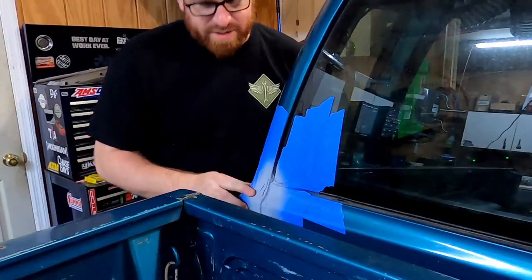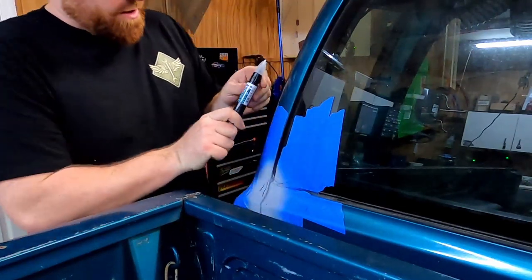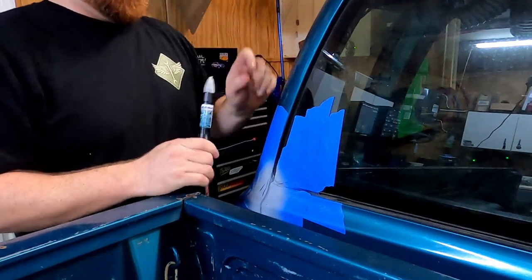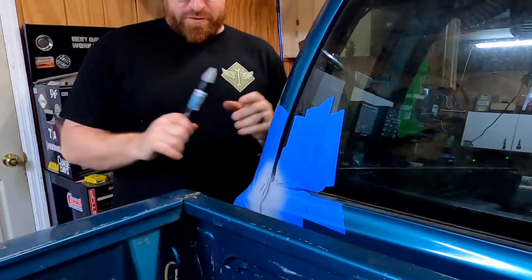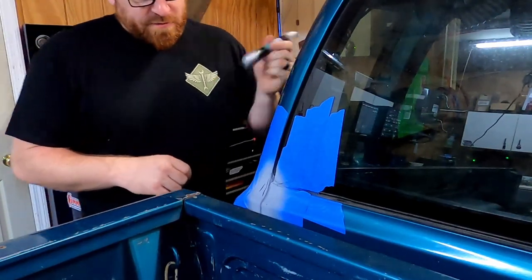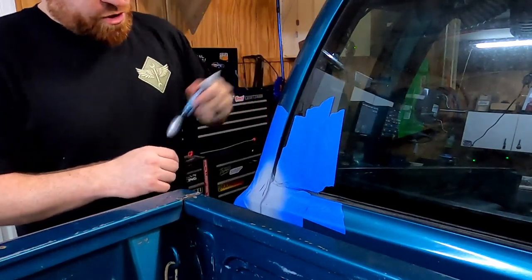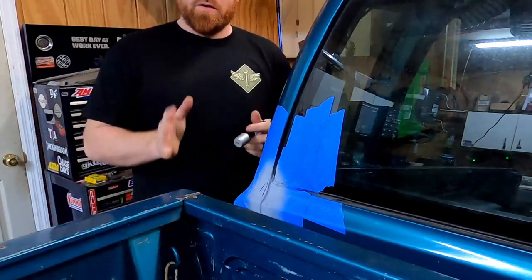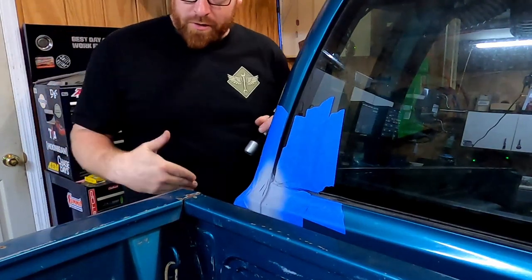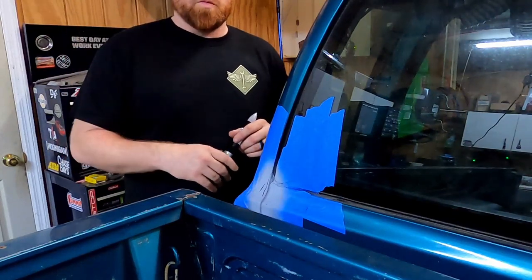All right, so this primer's had time to dry. Now I've got this touch-up paint pen from AC Delco, the bright teal WA9794 paint code. Again, can't get it in a spray unless you order it from a specialty store online or from your local paint supply store. So we're just gonna shake this like a Polaroid picture, brush it on there. The only caveat, it will take longer to dry than a spray will. But I'll put a coat on, let it dry, come back, put a coat on, let it dry. Make it look good. Once it looks halfway decent, clear coat it.